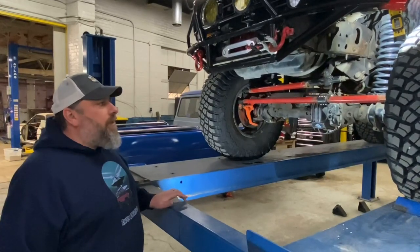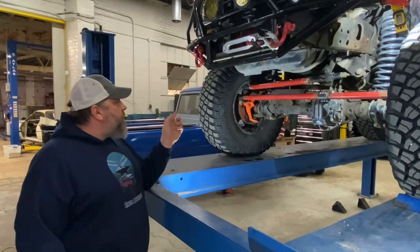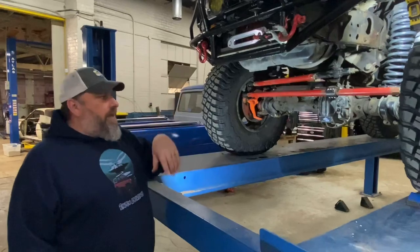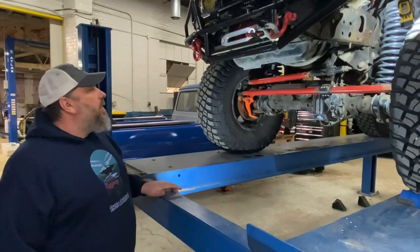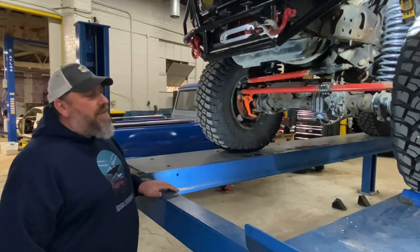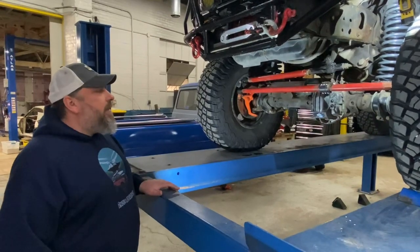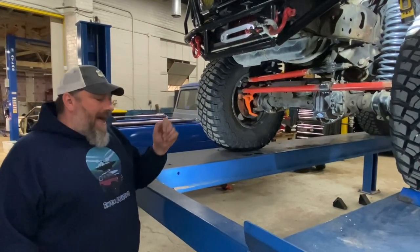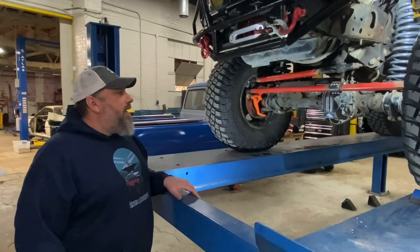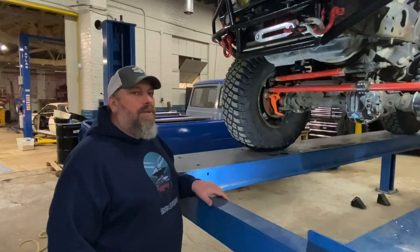And the steering works really good on it. I did add the Reid knuckles to it for the high steer. So we do have one high steer arm on this side, and then that controls everything else here. So the steering works really good. Without the PSC ram and the 37s, I tried using the original Explorer power steering pump, and with the front axle locked, no dice on the steering. So having the PSC, and then now I have the air locker, that's a nice combo.